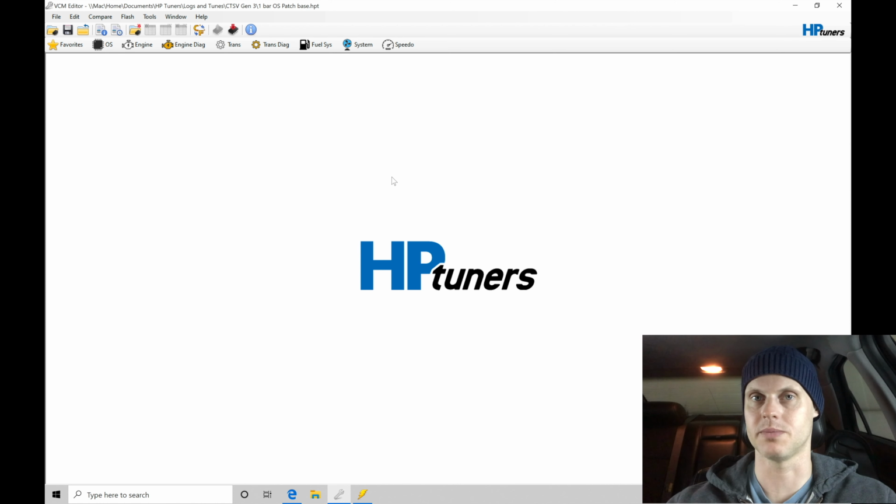So we don't want to go in and just make a million changes and then try to undo all those changes. It's better to start off with near stock values, or as close to stock values as possible, in all of our tables, and then start to edit things as we go on within the calibration process.